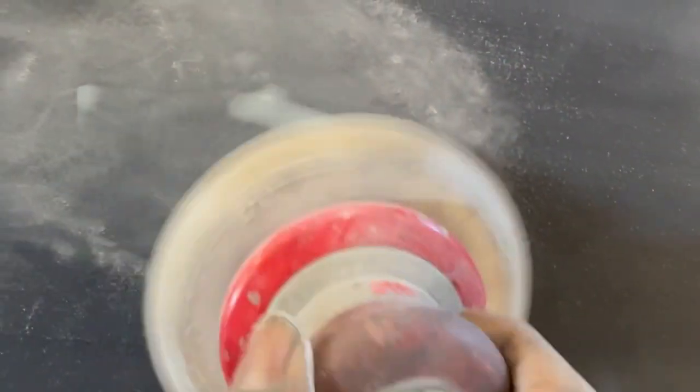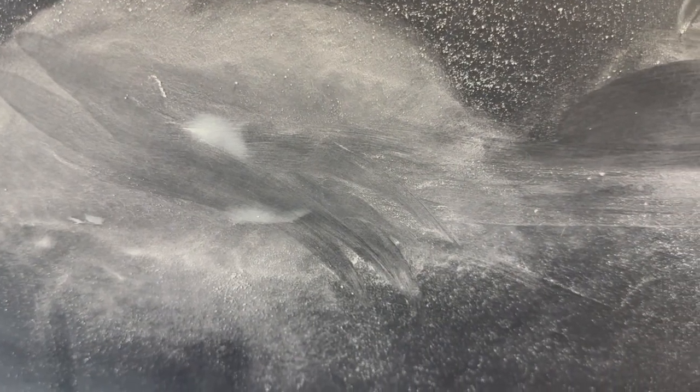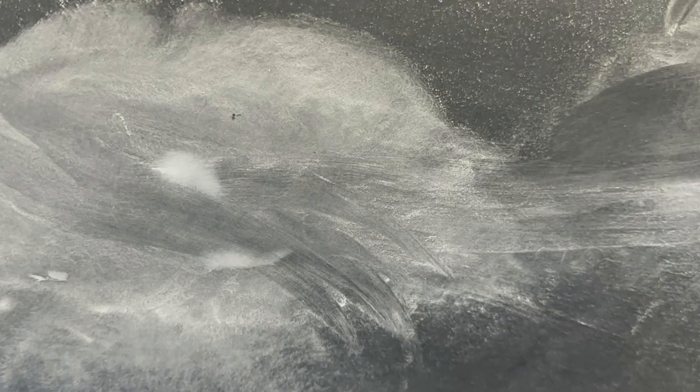Sanding with 320, that's all I'm using. You can see it just starting to fade away slowly, but you can still see the little rock peck a little bit in there — but you can see what we filled it up with. I ain't have to do that feather edge or anything like that. I ain't got to worry about if it's grooved or dented in, because sometimes when you feather edge it looks like dents — but that's just the layers of paint and stuff.